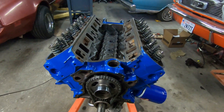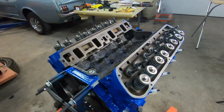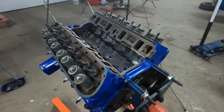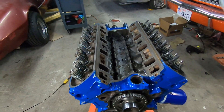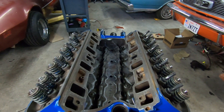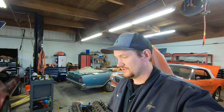Okay, we have cylinder heads on — probably one of the easier things of building your engine is just slapping some heads on. You just got to watch out for those head gaskets, make sure they're installed correctly, get your dowel pins in, and torque her down in the right sequence and you should be fine. As always, appreciate you being here — I hope this whole build series is helpful. Go ahead and subscribe and hit the like button; it does help us grow and produce more videos for you guys.